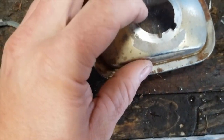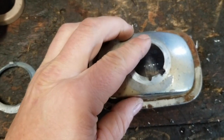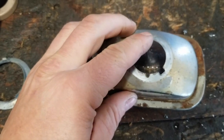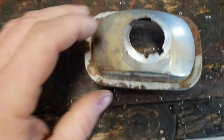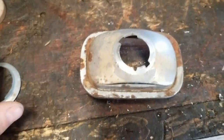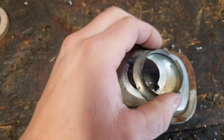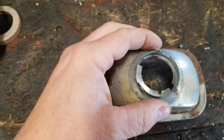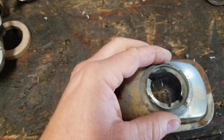You can see I cut out the connector for the H4 and that's going to go on there. Now I just need to slightly open this up to 38 millimeters, which isn't much. I'll use the die grinder a little bit and then use some Devcon to put this on here, and that's it.